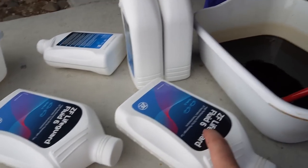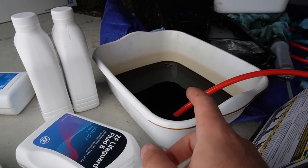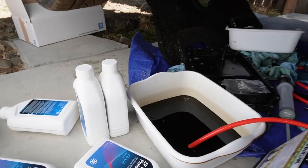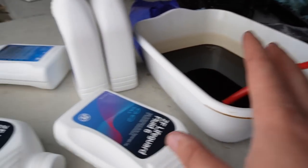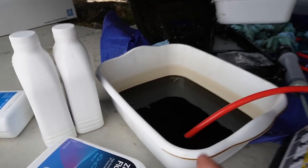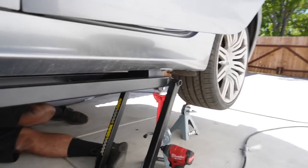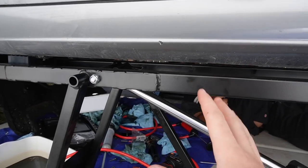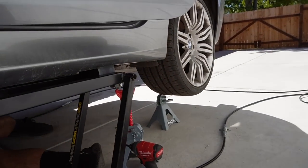So far it took five bottles, and we put in a little bit of the old fluid — actually a lot. The reason is this transmission has over 200,000 miles and some of the old fluid is technically considered good for it. So we put in the old fluids plus five new quarts, and it finally started dripping. Fingers crossed — we replaced all the sleeves, gaskets, everything, new pan. Let's put the car in gear.